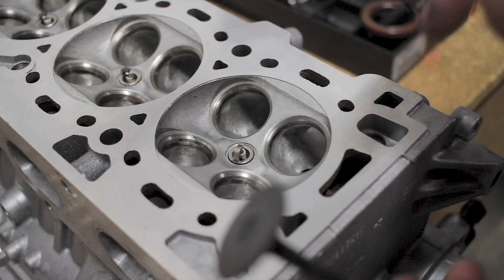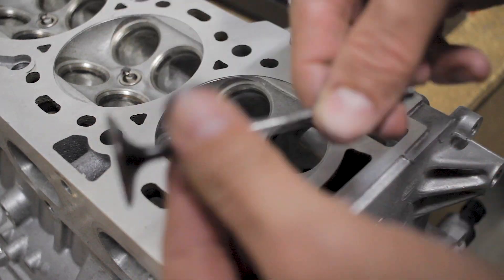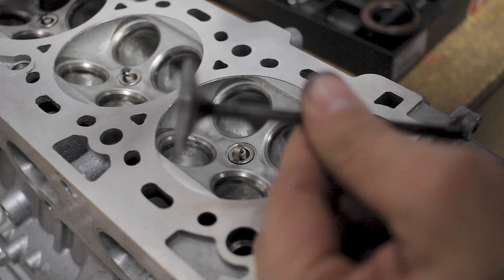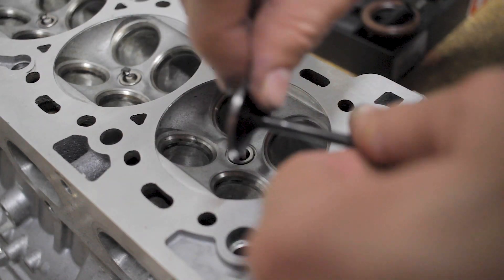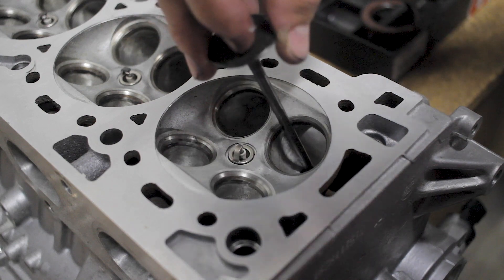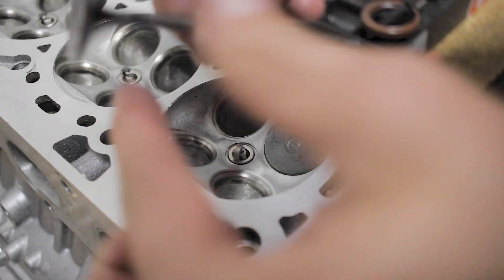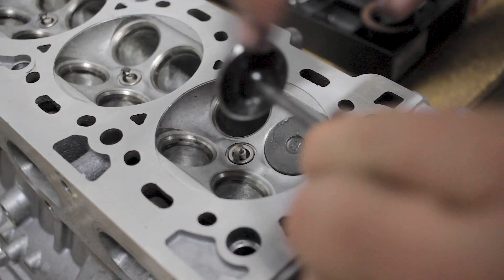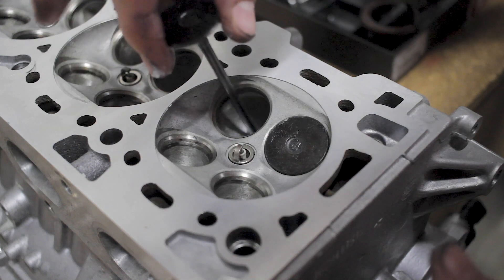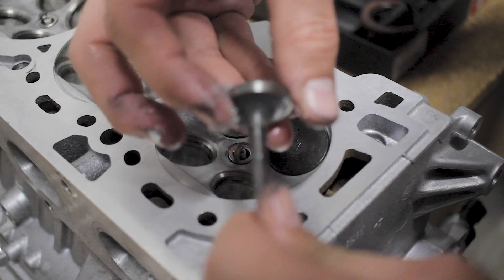This is going to be a pretty simple process. I'm going to take one of my intake valves and put a little bit of petroleum jelly on the stem and then the face of the valve — that will help seal things and keep the valve from being dry. We'll toss that in there, then repeat the same thing for this valve: a little along the stem, a little on the face. Then I'll do the same thing on the exhaust side.